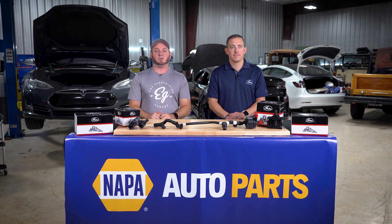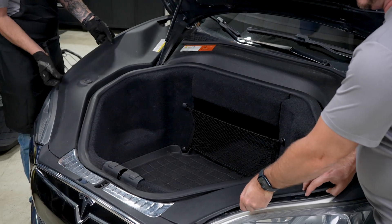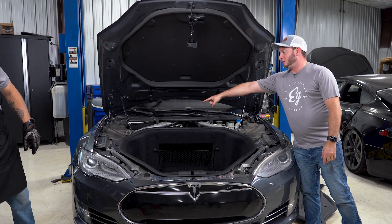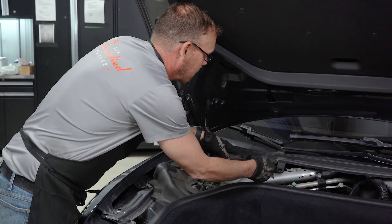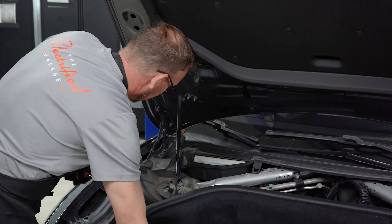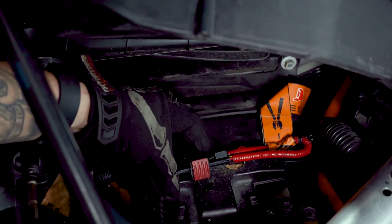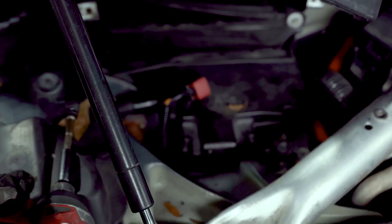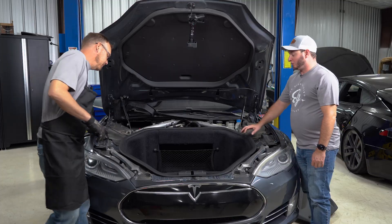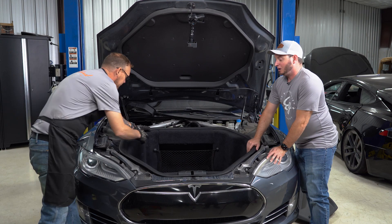Once the coolant is drained we'll head back over to the frunk to remove the trim panels and access the parts we're going to replace. These panels come off pretty easily — you don't actually need any tools, you just grab and pull. Now that the panels are off we need to access the 12 volt battery, which is underneath where the cabin filter is. Travis is going to pop the rivets, we'll take out the filter housing, and you'll get access to the 12 volt battery and the fireman's loop — the high voltage interlock loop. We need to disconnect that, which disables the high voltage, and then disconnect the negative terminal on the battery so the high voltage system will be disabled. Then we'll remove all the carpeted panels and the mat in the middle to access the fasteners, remove the tub, and gain access to all the parts we're going to be replacing.